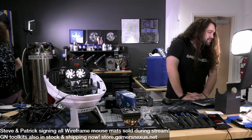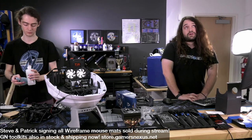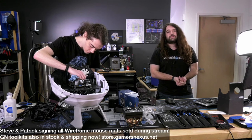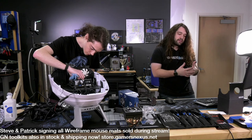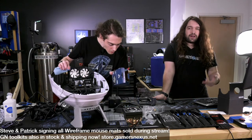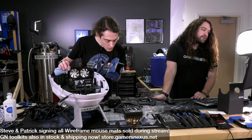As for the comment about F-clock tuning, if AMD's still saying that 2000 F-clock is possible, I guess in the purest technical sense, that's true. But we haven't been able to hit 2000 on any of the CPUs I've worked with from Zen 3. They originally said you can hit 2000 during the review cycle, and then no one was hitting 2000. Then they said, well, wait till the new AGESA comes out. New AGESA came out, and I still couldn't hit 2000 on ours. So no amount of tuning worked for ours.